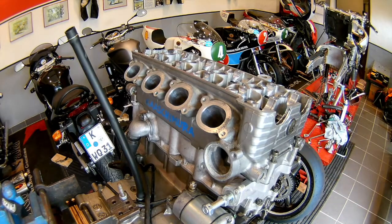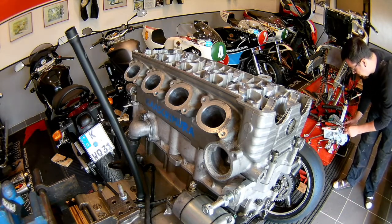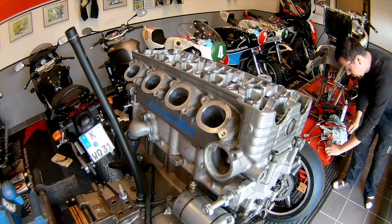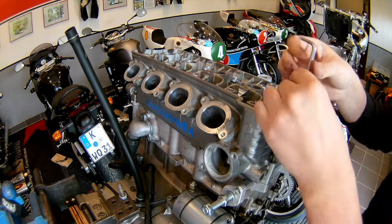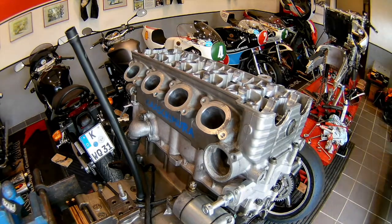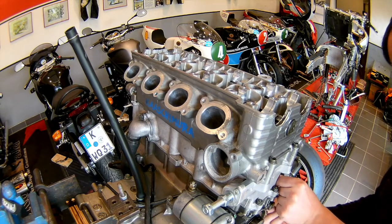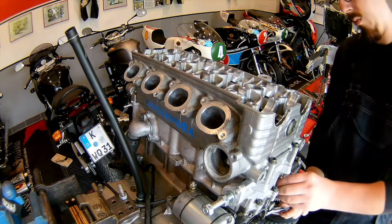Just some extra bolts — these two bolts, just standard M6 bolts. I tried to put all the bolts that were in this engine originally to one spot so I can reuse the same bolts — of course with the correct length of bolt and head style — without going to search for bolts in the workshop. As you saw earlier when I was taking off the old head, there's one bolt from underneath the front of the cylinder head. This bolt is quite important.